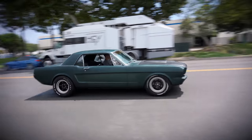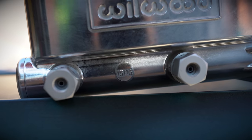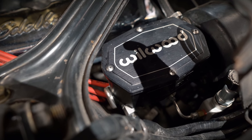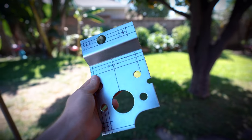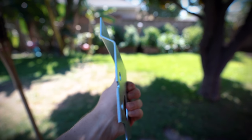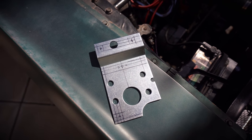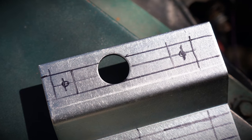A huge shoutout to Mike — he hooked me up with a new master cylinder, which is what we'll be installing today. I also noticed my firewall was flexing. That's not a Willwood issue, it's just a general Mustang thing — the firewall is super thin, like paper thin. So I'm installing a reinforcement plate on the firewall, which was only $35. I have low expectations, but Trans Am racers use crazy bars connecting to the shock tower, so if $35 even helps a little, that would be awesome.